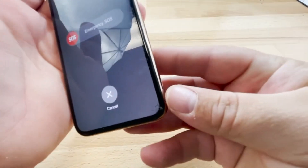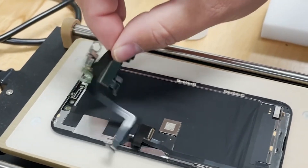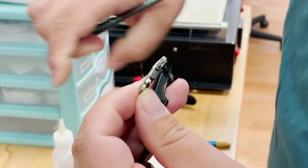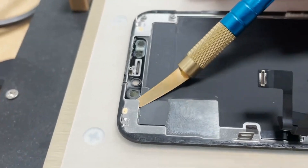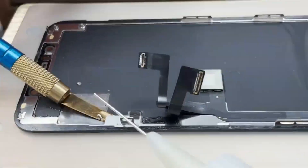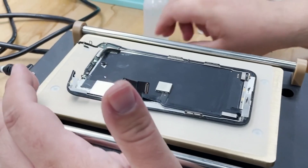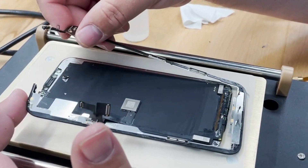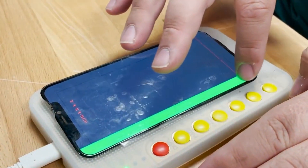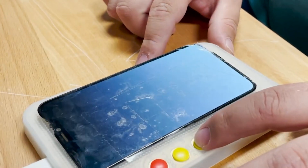As you can see, the iPhone we're looking at today has a crack in the corner, but the display and the touch work perfectly. One of the most complicated parts of this repair is working with the bezel, which you don't have to contend with as much on anything previous to the iPhone 11 Pro Max. With a few strategic cuts of the bezel with a grinder, using specialized tools like this extremely flat and flexible metal tip, with the assistance of isopropyl alcohol and a delicate touch, I'm able to go around the border and remove the bezel. With the assistance of some heating platforms, I'm able to safely remove the entire bezel without damaging the display. Then with the use of a tester, or going straight to the phone itself, we can power on the display and test the functionality to make sure the process is going smoothly. Once the bezel is off and everything works, we're over one of the hardest parts.